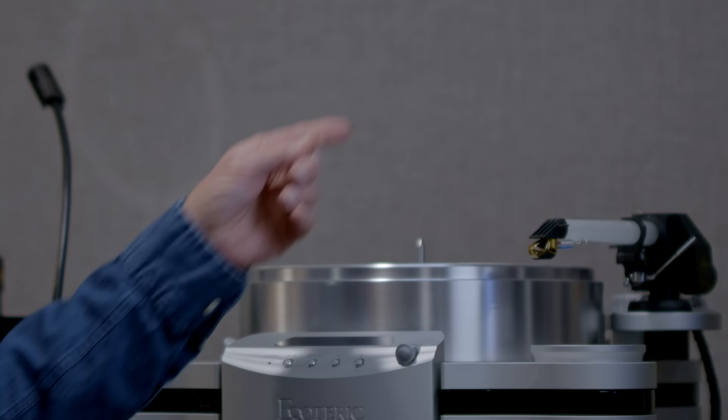You can actually adjust the sound of this — not the speed, but the sound — by changing the distance between the motor and the platter. They give you a micrometer adjustment for that. The sound of this turntable is more like an idler wheel drive — it's got that kind of punch, but there's no noise and rumble. You can change it from sounding more like a belt drive to sounding more like a direct drive. The 42-pound platter sits on a beautifully machined bearing that is magnetically partially levitated, so the thrust pad doesn't see the full 42 pounds.